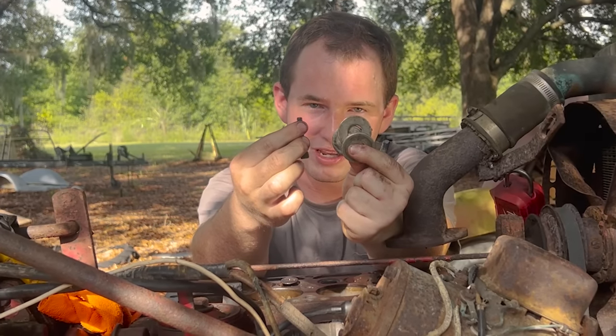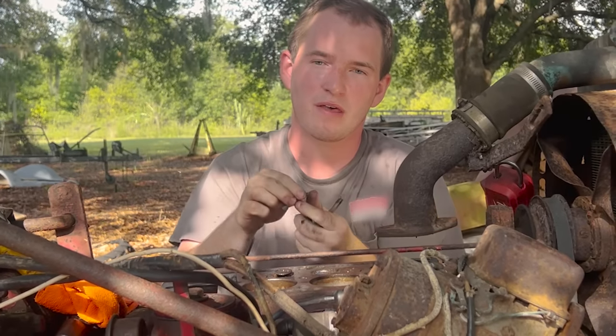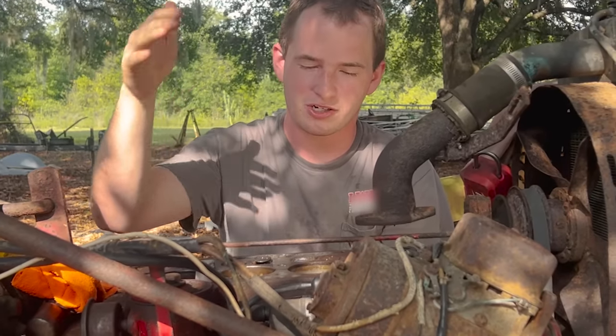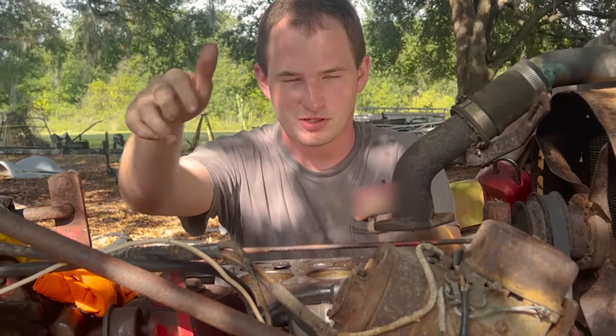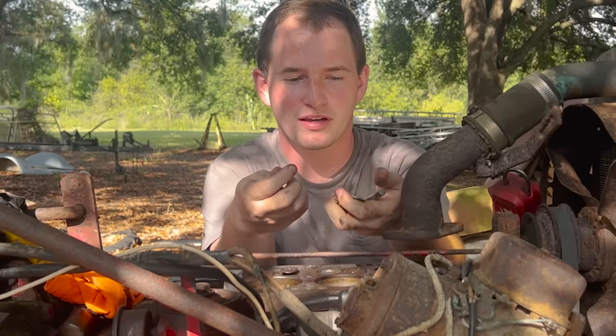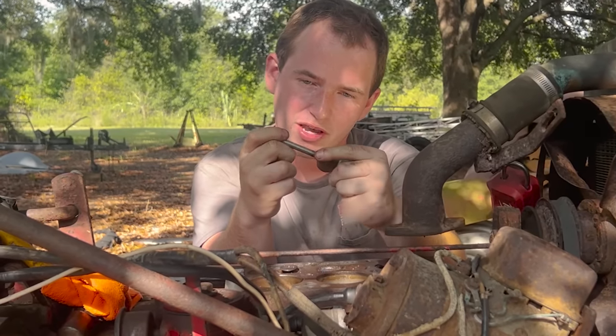And then I kept shimming it as it was going, just turning the starter over. And then I had to make sure I had the whole rotation of the motor with enough speed and inertia to push it up, because if you were just tapping the starter, it just wasn't doing it. I finally got the valve out. We got a new valve on the way, new spring.